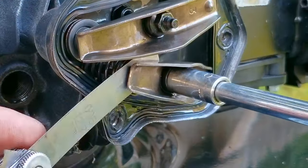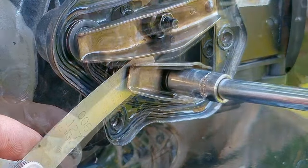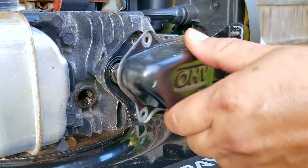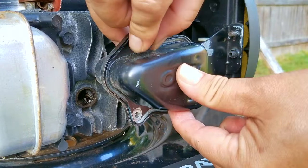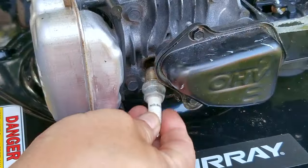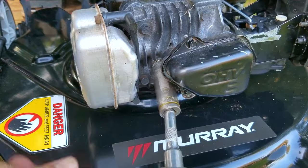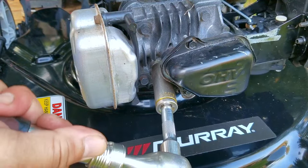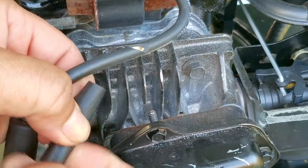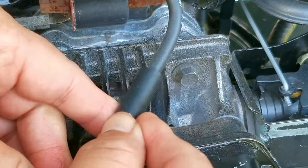On this rocker arm, I ended up turning the nut just a bit too far and the feeler gauge got stuck under the arm, which is not what we want. In that case, just turn the nut the other direction until it's loose again and then try it again. For those who may not know why this clearance is so important to maintain: the clearance is there to help for the expansion of metal when the engine gets hot, but over time these clearances change — mostly by getting larger. So when the clearances become too far off, especially when several times larger than they should be, this will affect how the engine starts and runs. If you want your engine to be easy to start when hot or cold, keeping the clearances in tolerance will help out a lot.